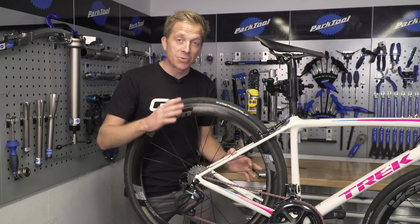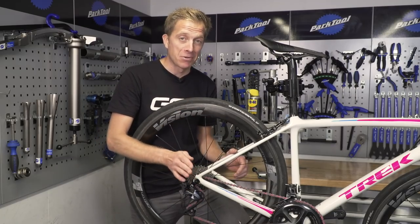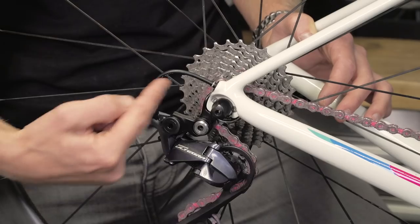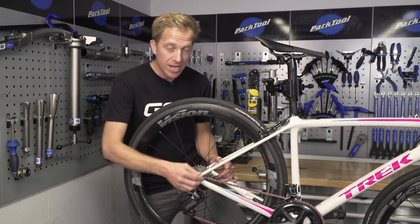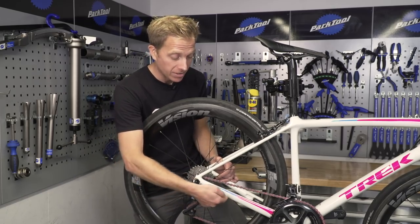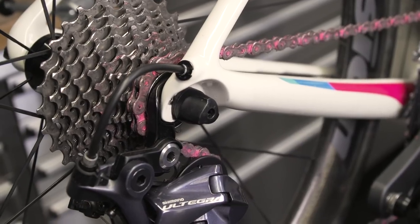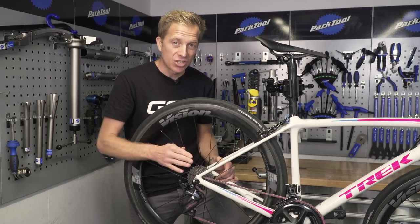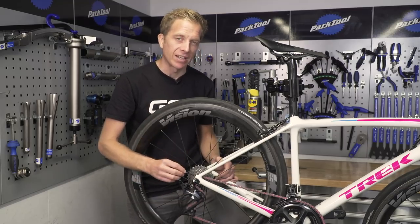If the bike has a continuous length of outer cable all the way back to the rear derailleur, you are laughing, because those systems are almost foolproof and give great shifting. However, in this case we have a little bit of cable which comes out of the rear triangle before entering the rear derailleur. The most common exit is underneath the chain stay. You want to make sure it has a nice loop going into the derailleur snugly — not too short and tight, and not too long and loose, as either extreme gives poor gear shifting.